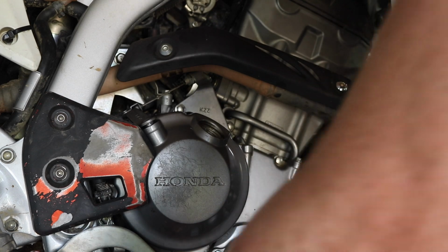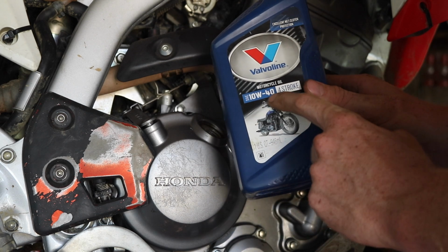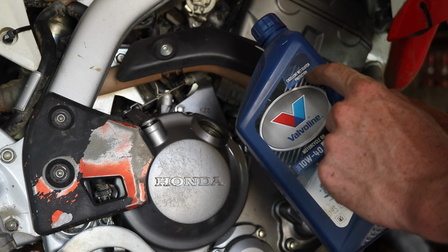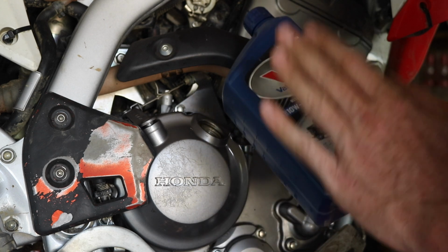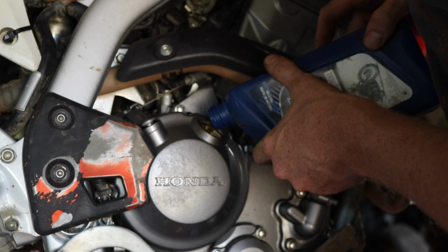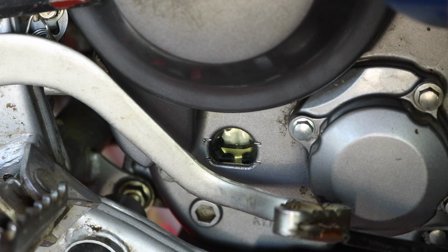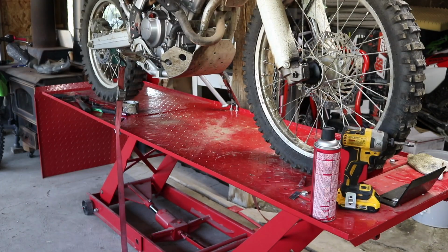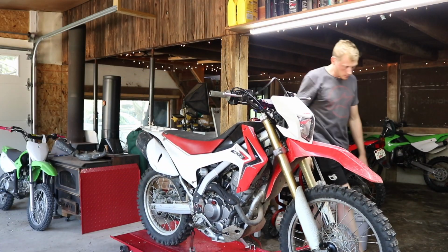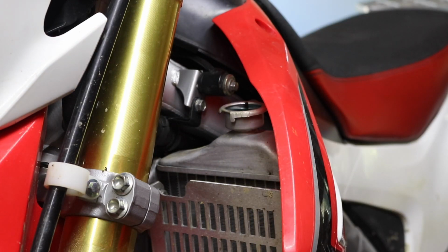And top her off with oil. Should be about 1.6 quarts since I had it drained like completely. I use Valvoline 10W40 motorcycle oil. Excellent wet clutch protection. This is good stuff. I've always used it. Link down in the description below. Woo! She's a full one, bud.